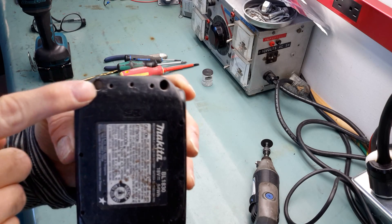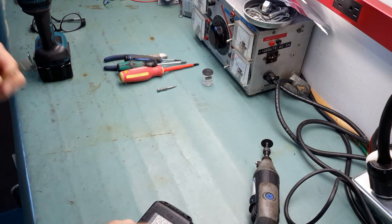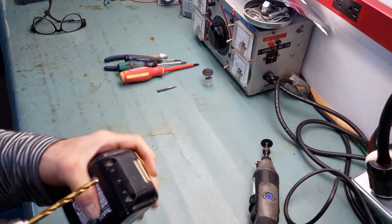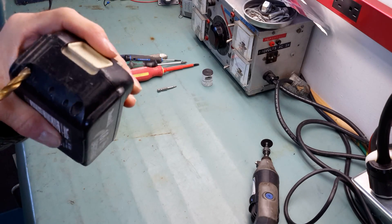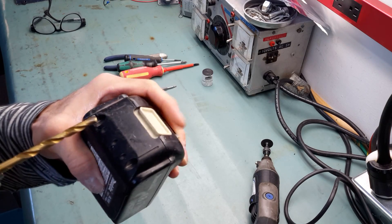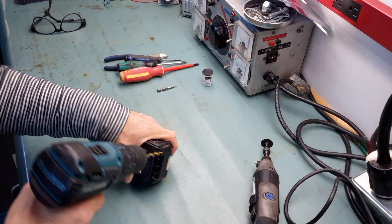One of those holes has a white plastic cover, as if they don't want us to disassemble these packs — however we are able to. I'll use this drill bit at slower speed. The goal is not to shave with the edge of the drill; what you want to do is just for about half a turn or one or two turns, dig into the plastic by forcing hard on it. Take a look at how I proceed.